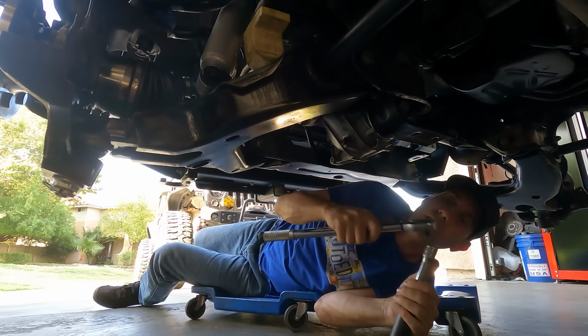Now, the one thing you do before you install the tie rod ends is put a little anti-seize out here on the end of these things where they screw into the adjuster sleeves, because if moisture gets inside there and these rust, then they seize up and there's just no more adjustment. That's no good. So you just do a little bit of preventive anti-seize goodness on the threads here and put these back together. All right, so let's get them installed.